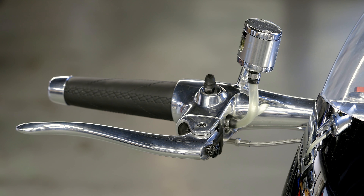Going forward a little bit farther we've got one of our five-and-three-quarter LED headlights. Inside the gauge surround we have headlight plugs and gauge plugs. Throughout the rest of the bike we've got hidden Mizu connectors that we sell on the web store — we chose those because they're waterproof and tiny. It's really difficult to find high-quality waterproof connectors that are not large for motorcycle applications.